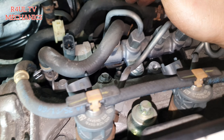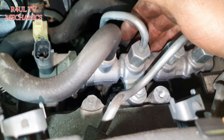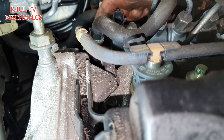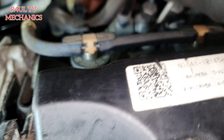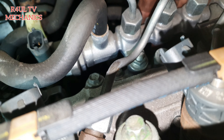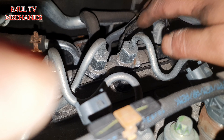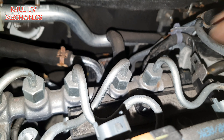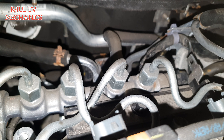After we take that bracket off, you can just make out where my finger is — there are the glow plugs, right down here. The fuel rail is on one side and on the other side of the fuel rail is where they are. There's one here, one there, and another one on that side where that wire is going — that's one of the glow plug wires as well. We're gonna pull them off and hopefully take the glow plugs off.